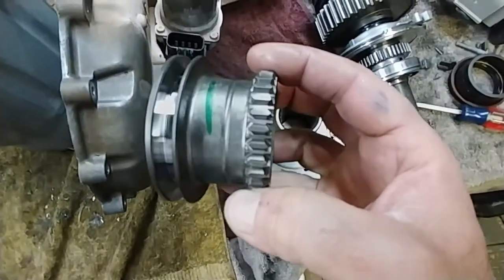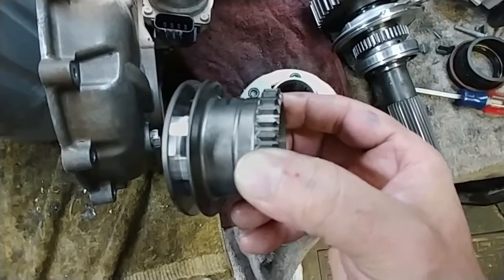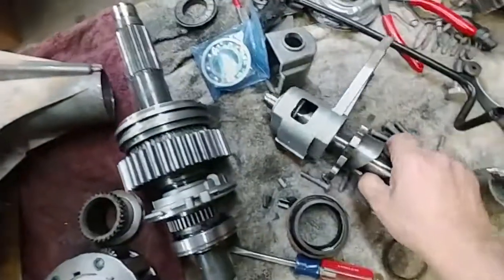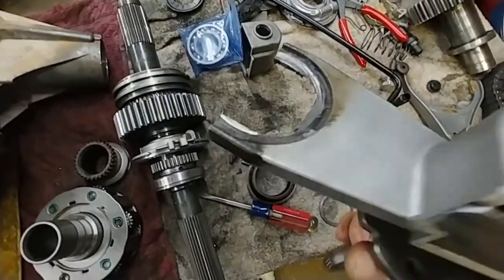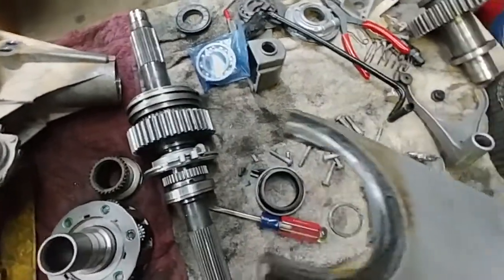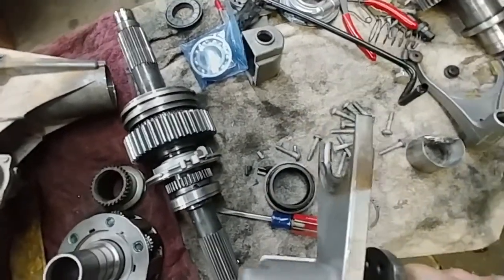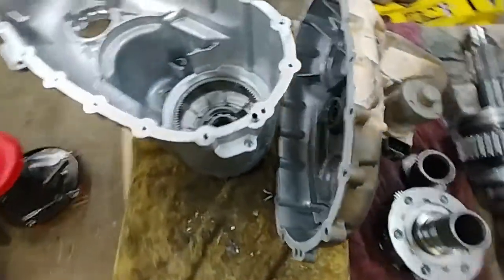And you can see on this clutch how straight those teeth are versus the other one. Yeah, the other one was quite wiped out, and that's why it would clunk. My guess is under load, it would skip a tooth. And this poor guy did the best it could to keep it in position, but you can see it just wasn't enough. You see how hot that thing got? It's all burnt. Yeah. That's 700 miles of abuse. Yeah, it didn't last long, but it got me home. That was the main point in that. So we'll put it all together.